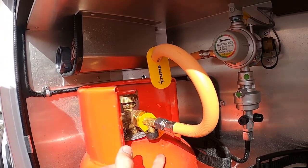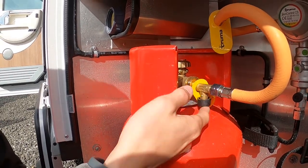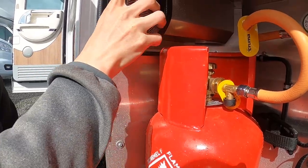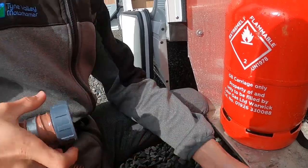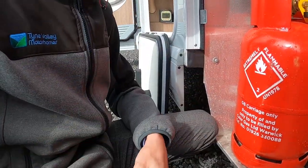When you do turn the gas on, press this little black button here — it allows the gas through the crash valve and into the van. You've got the storage facility here for your extension for your waste, which will clip on and extend it a little bit for decanting your waste off the van.